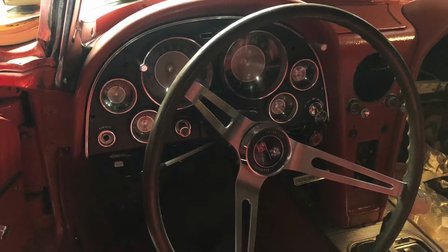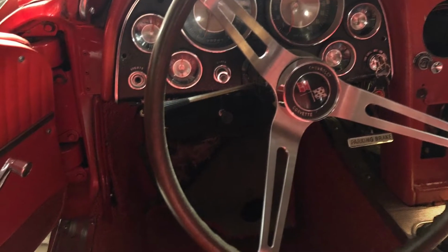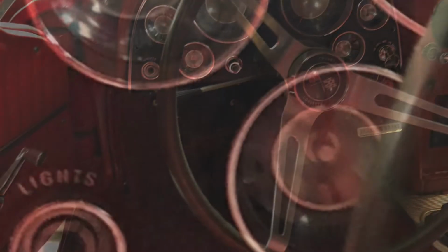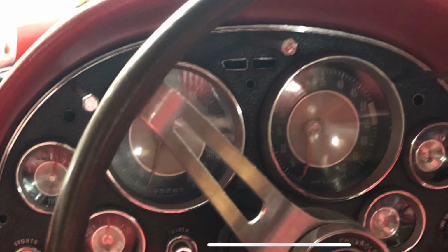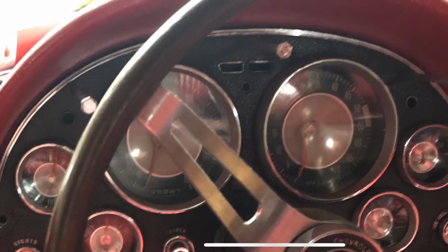Once you have gotten the cluster dash install screws out and positioned where you can reach the wiring harness connections, you'll need to disconnect the gauges, ground, ignition switch, lighter switch, light switch, actuator switch, and the copper oil line connection. Be warned, this is not a job to take lightly, and use a small screwdriver to assist with pulling off the connections. The space is limited, and even the smallest hands will find it hard to get a strong grip on the connections. You'll also need a wrench to disconnect the copper oil line. Be sure to use a towel when doing this to catch the oil drips.